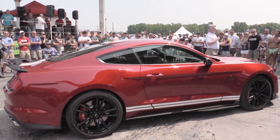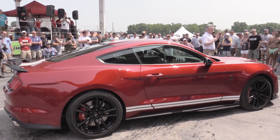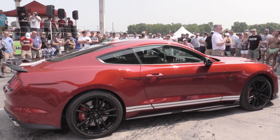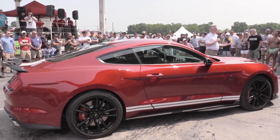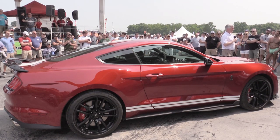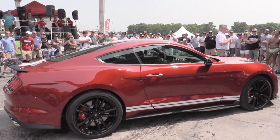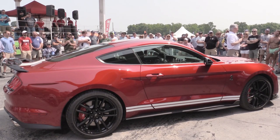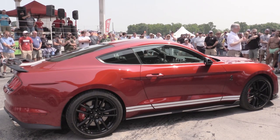We need both a powertrain and to get the rear wheels on the ground for grip. The most power we can get out of a forced-induction 5.2-liter — so the cylinder is taking 1800 PSI pressure at peak power. The block we started with from the GT350, we had to rework it: longer head bolts, more ribbing, bigger bearings, and we cascaded that back into the 2019 Shelby. The block itself had to be improved for that extra pressure, and the cylinder heads are all new and unique to the GT500 — new valve train, new seals, new cam timing.